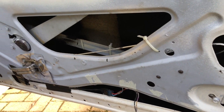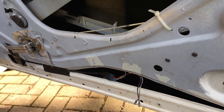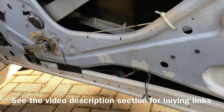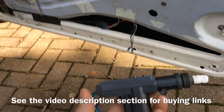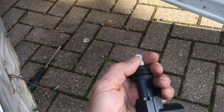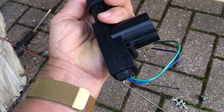I'm not going to go into all of the details of the central locking control unit, which you can get from eBay — it's just a matter of wiring that up according to the instructions. The tricky bit is how to interface into the doors. What you need is these universal central locking motors, which have a little motor that pushes a spindle in and out depending on the direction of the voltage applied to its input.